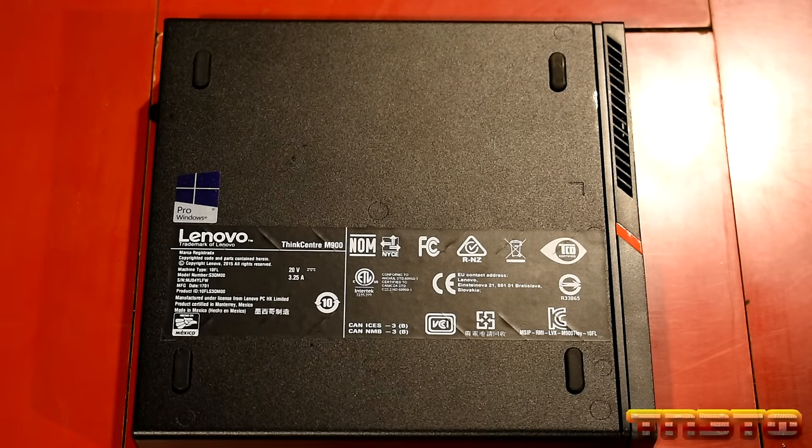So I'll go ahead and connect the adapter, plug it in. We'll POST this system, see if it sees the new CPU and the upgraded RAM. It'll probably complain at us because we upgraded the RAM. Usually the BIOS says, hey, you changed out the memory, and you just have to continue on. So let's go ahead and hook it up. So we have power applied.